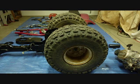Also, if you have a '84, '85 ATC 110, you'll notice that the hub was different. That hub will float forward and backward a little bit, and that's what is used to adjust the chain tension, the drive chain tension.